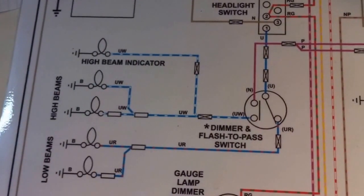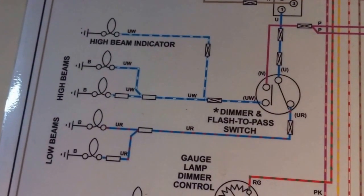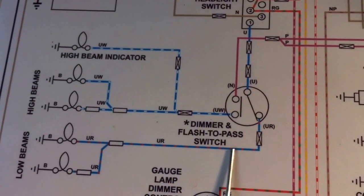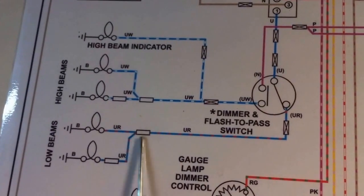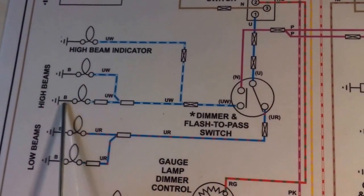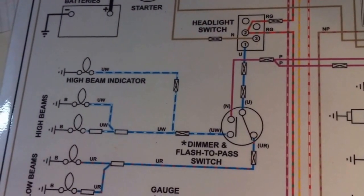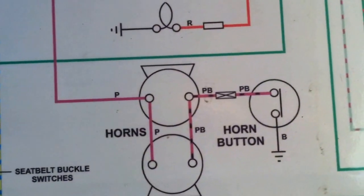So now we have the other three relays that I showed you at the start on the front of the vehicle, and what we're going to feed there is our light circuit. Basically those relays are inserted in at this position here at the front of the car. So this now is going to feed the coil on the relay and to ground, and in turn we're going to provide that switched power to the low beams, and this one other relay will provide it to the high beams, and we're going to take all of that current out of that switch as well. So now this switch is controlling just a couple of relays, which is a very low power draw, considerably lower power draw.